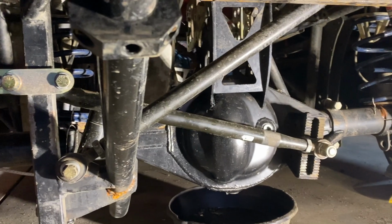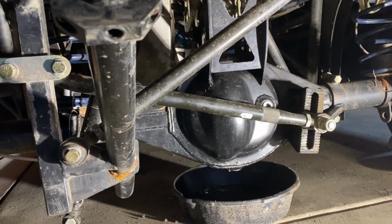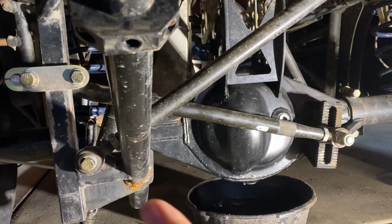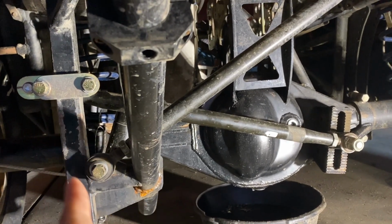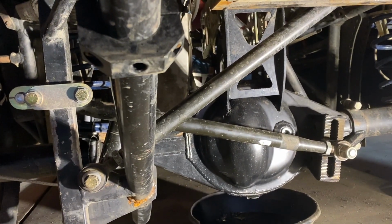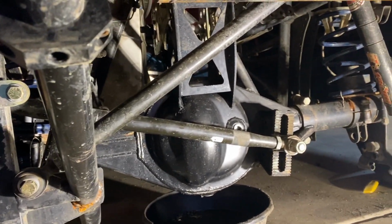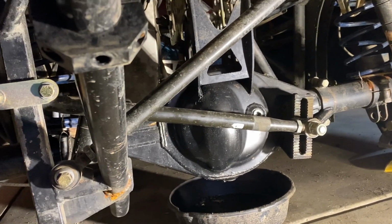Look at some of the changes we're gonna do. So this is called the panhard bar right here. I run about 7 inches in it and spread between the left side and the right. I think I'm going to lower this bar down here. And the lower that you bring the panhard bar to the track, the more it feels like the car is dug into the track. The problem is that you can kind of bog down the car a little bit if it's too much.